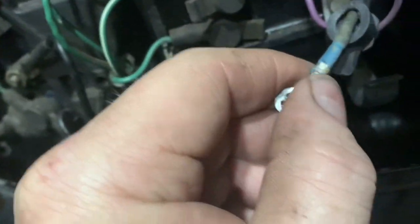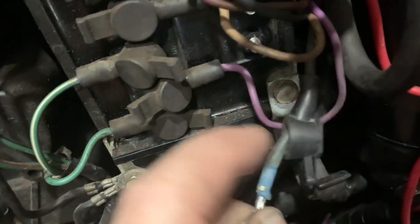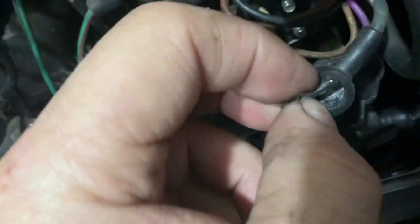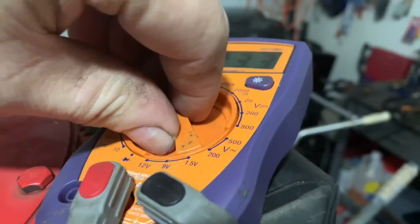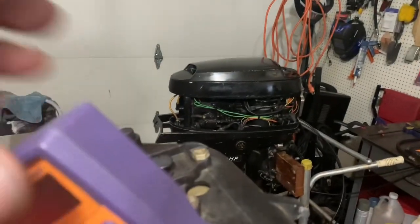The blue and blue-and-white — this is the blue, you can barely just make it out, but that's blue at the tip. It's actually turned kind of dark, you can't tell, but that's blue. And then the blue and white is right here — you see the white strip. It looks like it's turned black or green, I can't really tell, but when you pull the boots down you can see the blue and white. Blue to blue-and-white is supposed to be 5,000 to 7,000 ohms. I'll set my meter scale to 20,000.